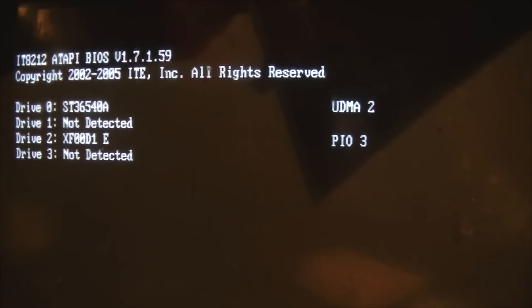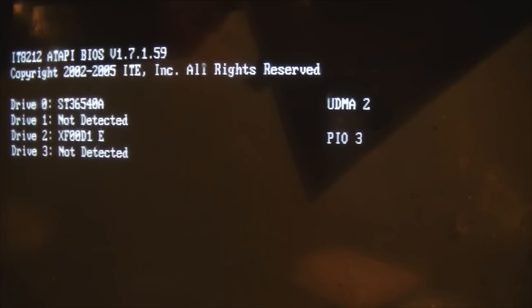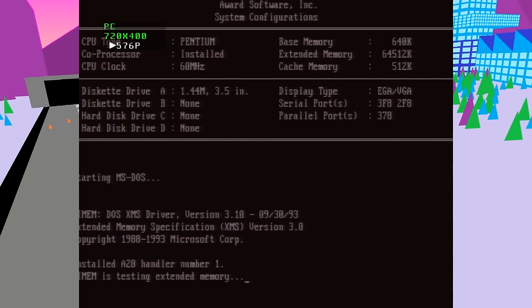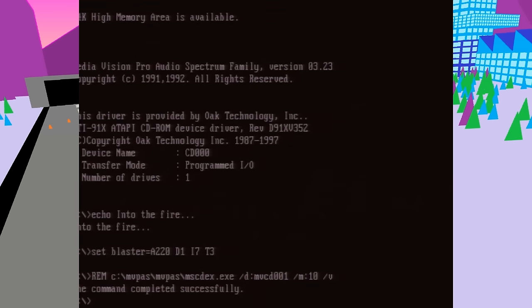I think my salvage capacitors aren't really much better than the ones I replaced, but they're going to last long enough for me to get another card somewhere down the line, I think. The drive is still corrupted from the old board anyway, so it doesn't really matter if this ruins the partition, as it's going to get completely wiped when a new card's installed anyway. I can't load EMM386 as this stops the IDE card working, but I haven't run into any software I'm running which actually wants that loaded yet, so that might not be an immediate problem.